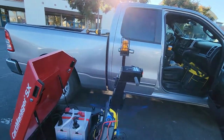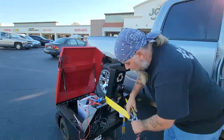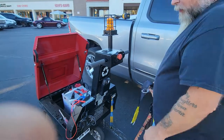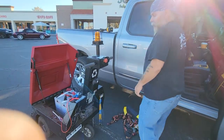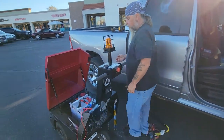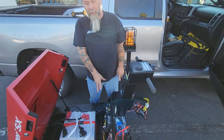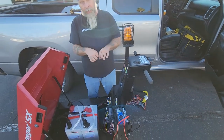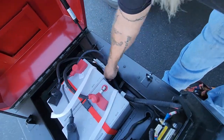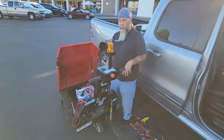The first place we're going to start — just like the electric carts, the charger needs to plug in every time it's not in use. Any time you go to do any battery change-outs or mess with any electrical on this system, it's no different than the electric carts where you need to unplug the quick disconnect. Come over here where this big gray quick disconnect is, pull on it and disconnect it. That's going to stop any type of surge going into your electrical components.